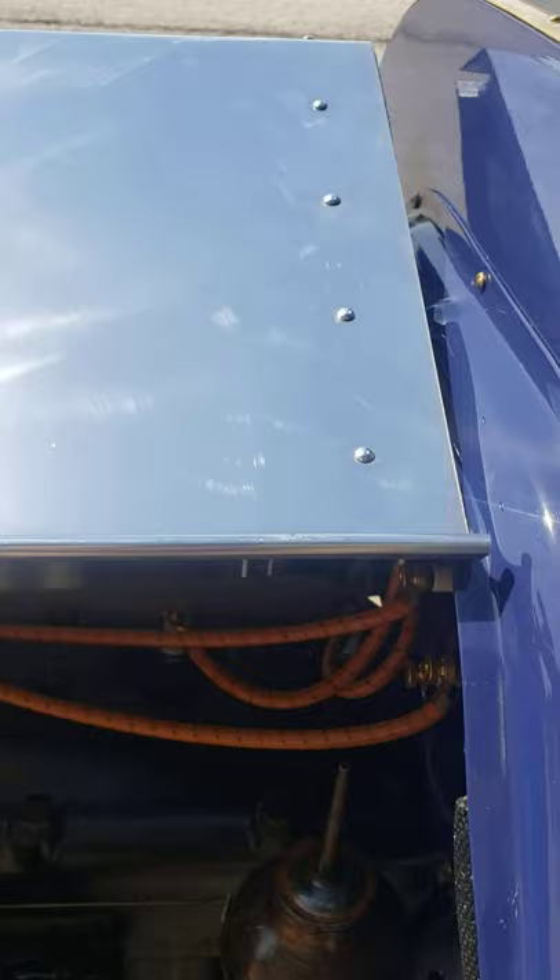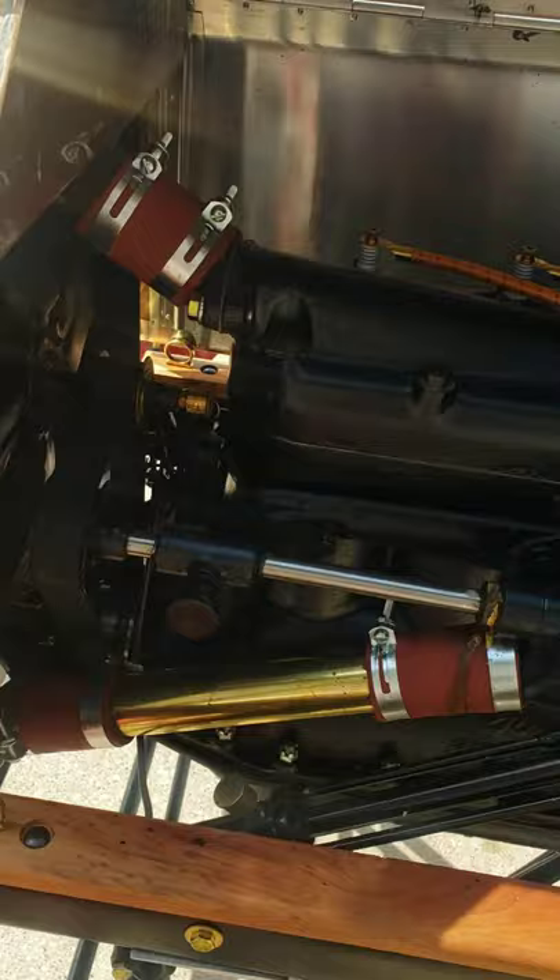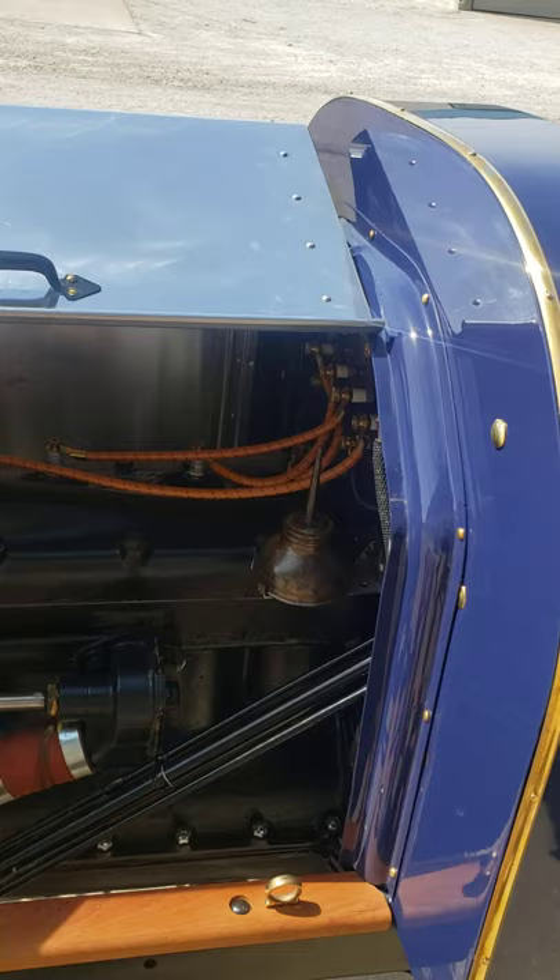On the other side it has its Ford accessory oil can with an accessory water pump. It's a very nice running car — probably runs around 35 to 40 miles an hour. It has a low compression head and 3-to-1 gears in the rear end for higher speed.